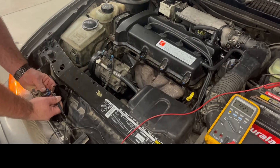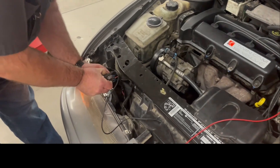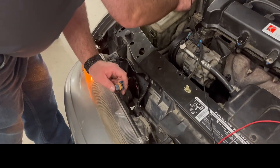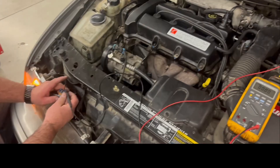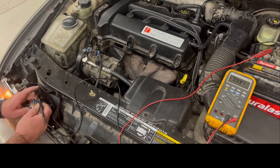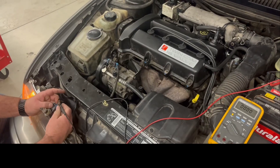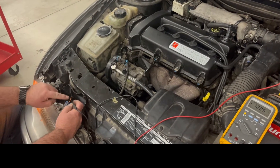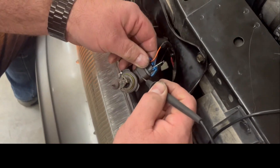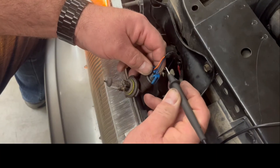Some of you are probably saying this is a little weird. We measured by unplugging this and saw 12 volts. But when I unplug it and measure negative to negative, I have next to nothing. When I plug this in - because this is the load with the circuit live - that changes. What that means is on this blue wire, I have something taking the voltage before it gets to this light bulb. We need to figure out where this voltage is being lost on the ground side of the circuit.